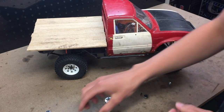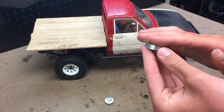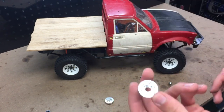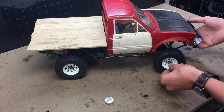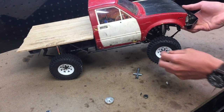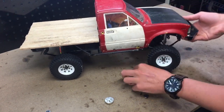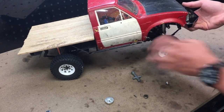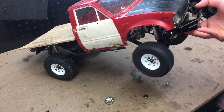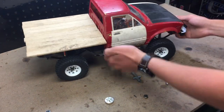I don't want to go too tight, simply because the back of the hub would rub on the knuckle. I could have used a smaller bearing size and machined it differently — that would work fine — but these were the bearings I had, so that's what I machined it for. As you can see it spins freely here, though it's rubbing a little. Loosening the nut a bit makes it really smooth. There's a little wobble because the tire isn't perfectly balanced and there's some slop in my steering knuckles.